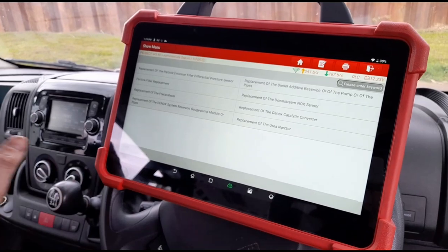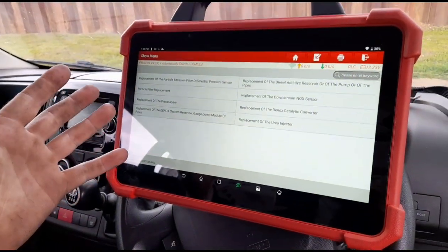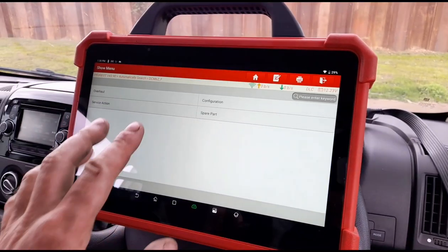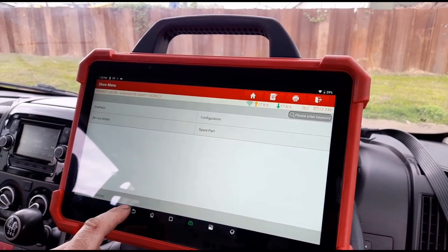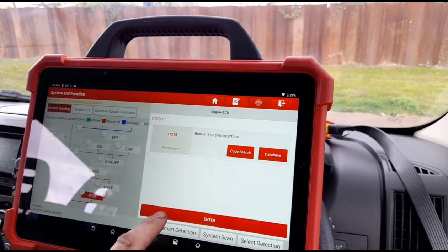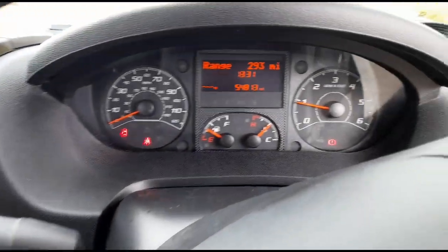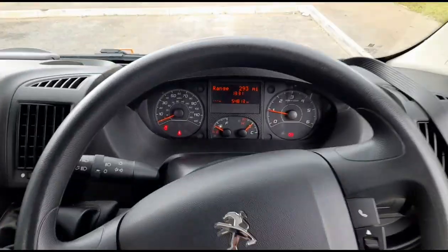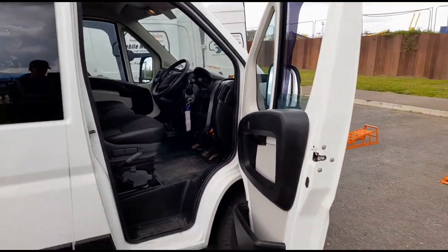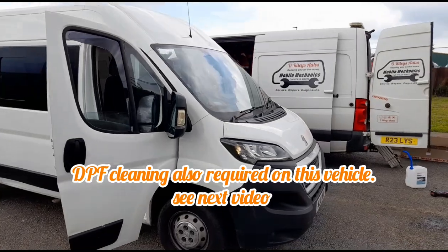The reason I do that is I don't want the customer driving away and then getting a warning light saying he's still got a problem with his D-NOX system, which might say the catalyst has reached its limit and needs replacing — this avoids that happening. We did also have a couple of other codes including P20EE NOX exceedance, but that should now be no more. The only code left I'm not really concerned about. So that's it — one AdBlue tank all fitted, pressure raised up to the right six bar. I keep saying millibars and calling the catalyst a particle filter, but the AdBlue tank is fitted, catalyst is working as it should, we've got six bar of pressure from the urea tank. All finished — see you on the next video.